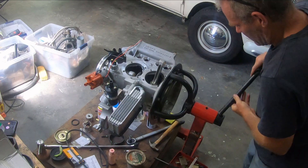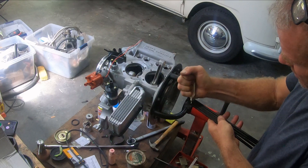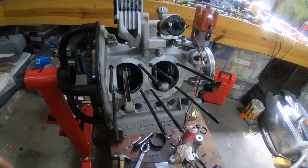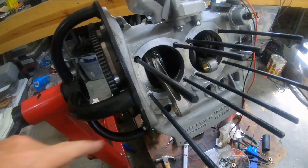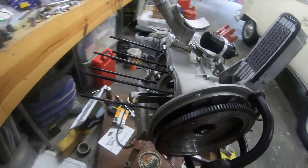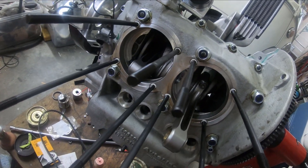On this side — okay, so basically what I've got here are my head studs. I'll go the long ones next to where the push rods go: long, long, long, long, and then medium on the corners, two short ones again. This is the deep stud — you can see the thread sealant in there. And if we flip it around and look on this side, I've got long, long, long, long, medium, short, short, long, and everything has its thread sealant in there.